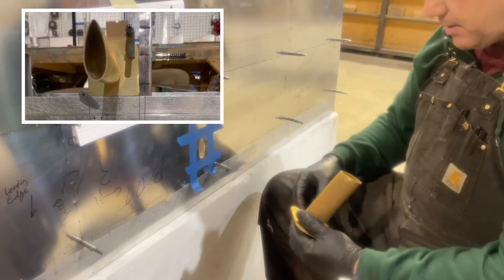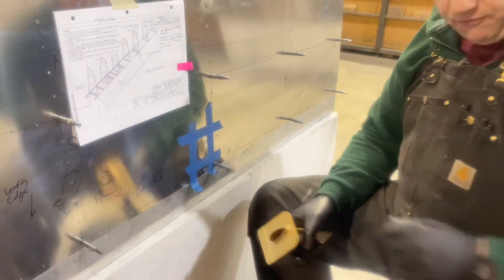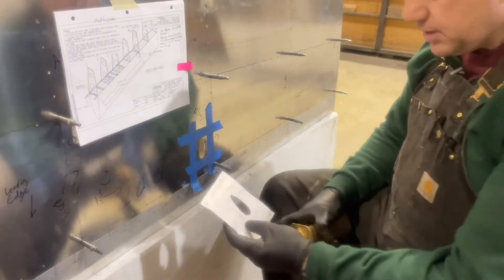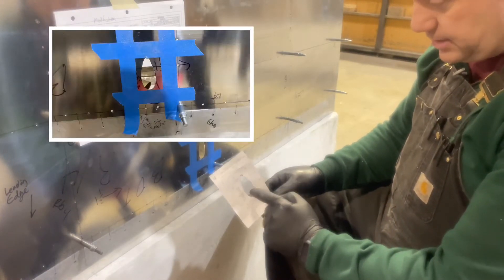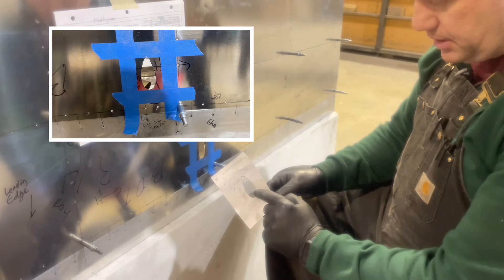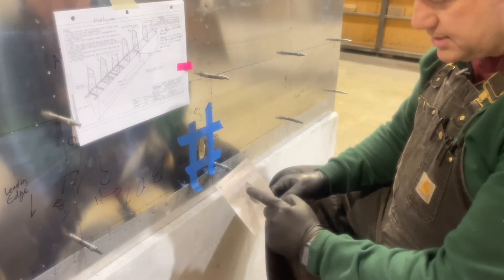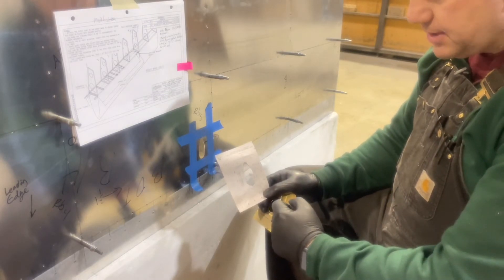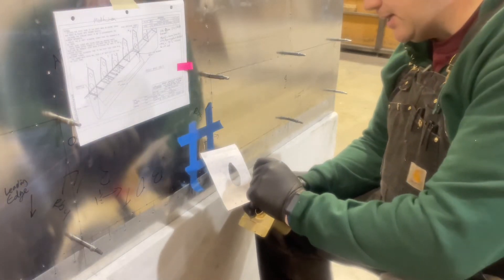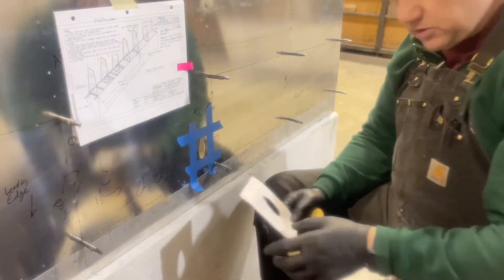I added two there, and then I pulled the skin off, mounted it up, matched up the template on the workbench, followed the instructions, used a 3/16ths and a step bit to take it up to a half inch. Then traced this out. Did a rough cut with the Dremel tool cutoff disc, and then used a sanding disc and then some files to just make it the rest of the way down.